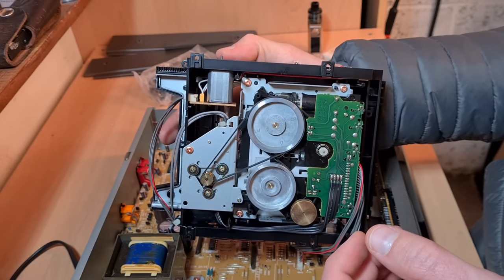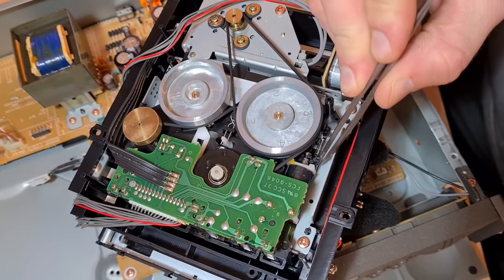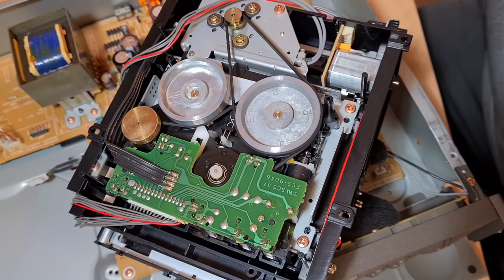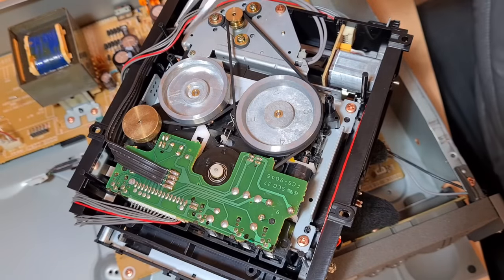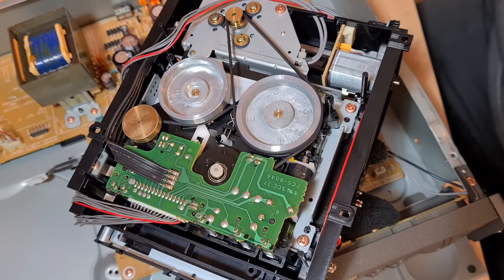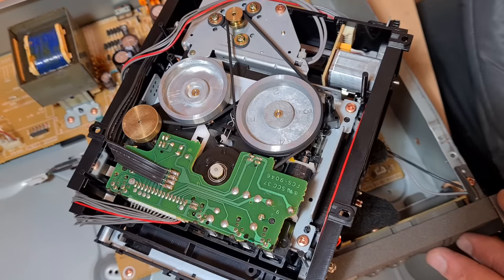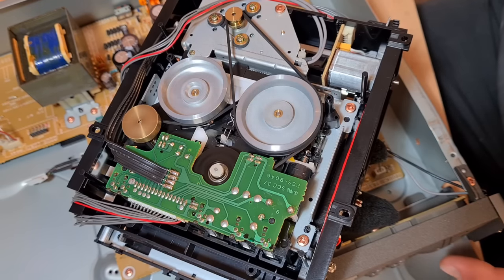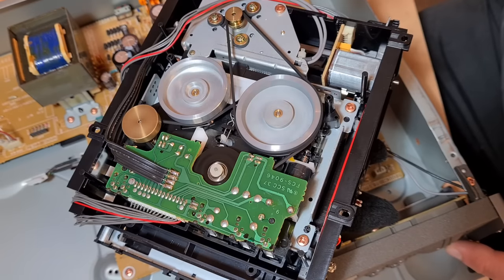Let's see if we can spot through a gap how that happens. From what I can see, this solenoid activates a kind of black flat piece of plastic down in there which activates a cog, and the cog should turn and in turn drag the heads up. The heads are on the other side. I'm wondering if I can very gently nudge it on its way - perhaps it's been stuck between modes or skipped a tooth or something. I'm going to try and play it and see what moves and tickle it on its way. That's just engaged.